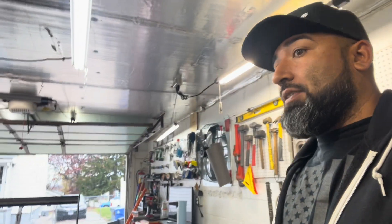I got it all squared away — it's not welded yet, I just gotta weld that base plate in. Basically I took a level off the end plate straight down, measured from the side of the tail light to the level on both sides, got that measurement even, then took a plumb bob off the top down to a blue line which is six inches off the Mayhem bar — and I used their welded-on logo on this side because it's six inches. Plumb bob was great on both sides. Now I'm going to come in, clean up some of this paint, and start to tack this in. I'll take the wing and uprights off, and I'm probably going to do a couple one-inch welds — welds aren't the greatest, but it'll work. This thing is super solid.